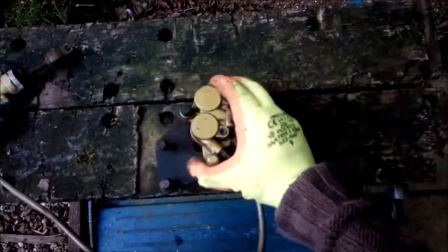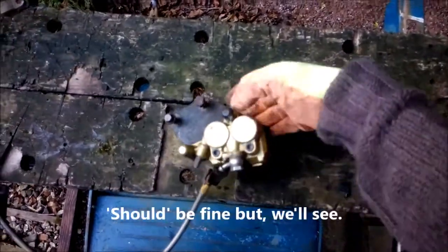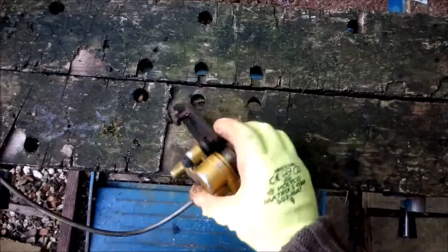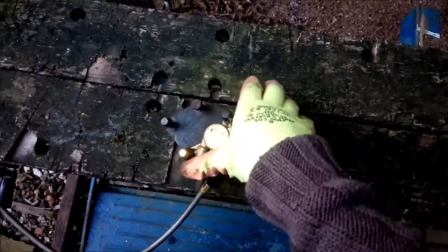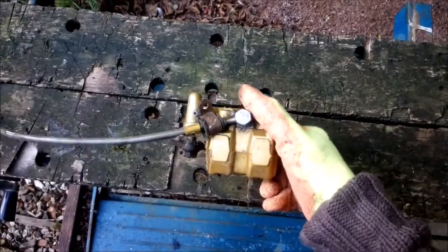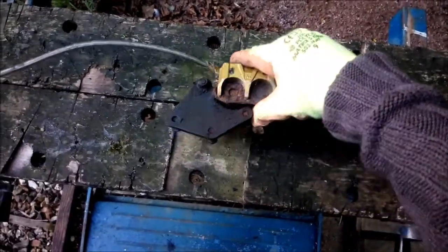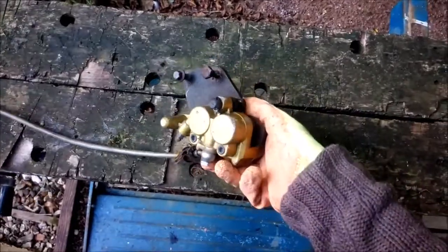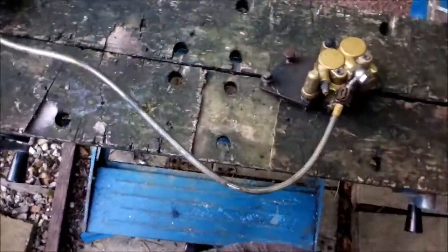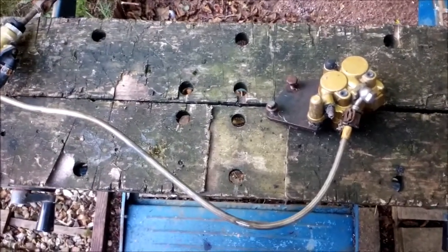The caliper itself seems fine — I've tested the pistons with a screwdriver and there's movement in them still, so it should be okay. The bracket needs to come off; I'm going to get the wire brush on that, spin it down and then repaint it. These bolts just need the threads going back over again with the die, cut them out and get rid of all the rust to re-cut them again. Obviously the brake pads need replacing. The caliper should be saved — it should be okay. The hose seems okay. Just the master cylinder that's naffed, and the pads. So a little bit of work to do there — just got to get a replacement universal master cylinder for that, for a few quid, it's not a problem.